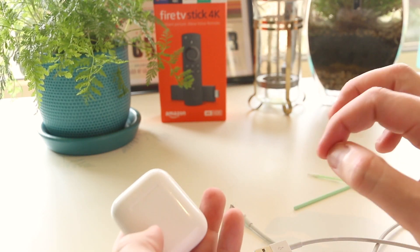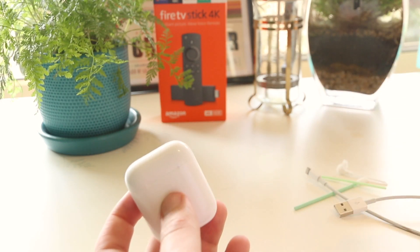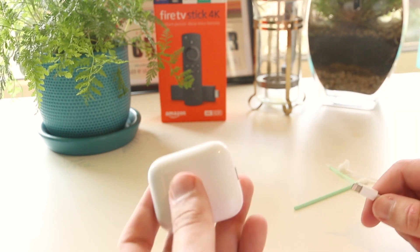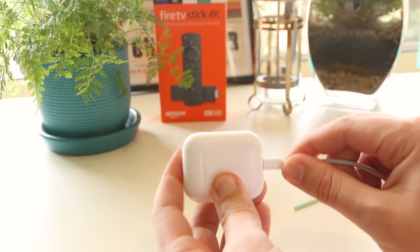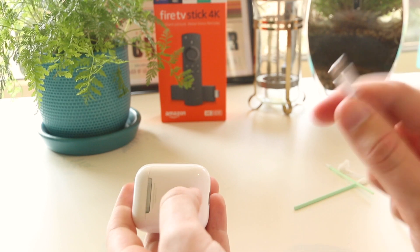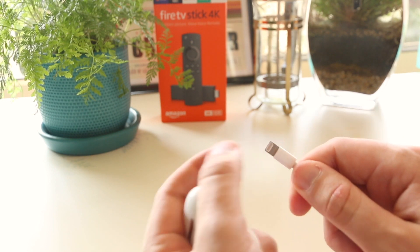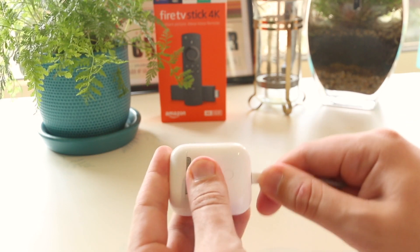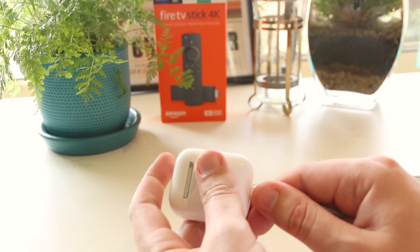If you don't have a high quality cable, you can get an Apple certified cable from Amazon. The one I picked up was $10 and it works perfectly with Apple devices — I'll put a link down below. The next method is to go ahead and get your lightning charging cable, insert it into your AirPods, then pull it out, and repeat this process maybe 10 to 15 times. This is an extension of the first step, as sometimes there's dirt, grime, or dust built up on either the connector or the charging port itself, so you want to insert it and wriggle it around to dislodge any buildup.